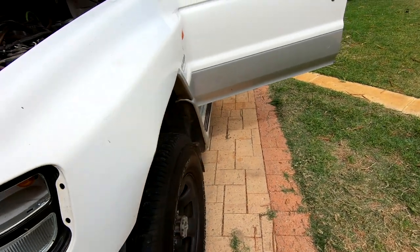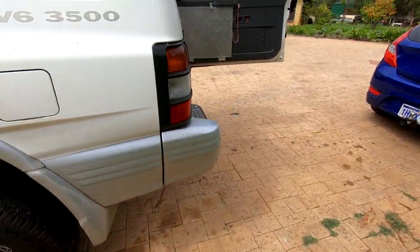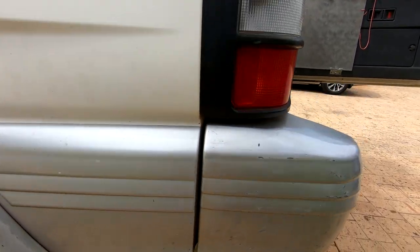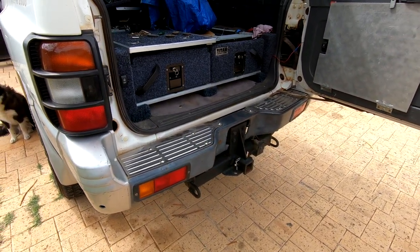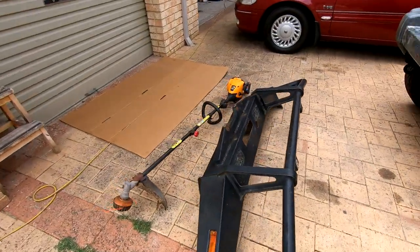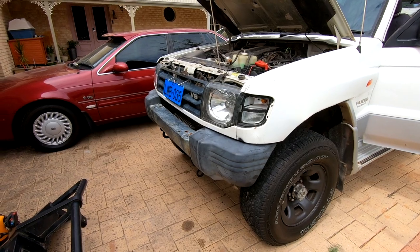On bumpers: if you're going to do a one inch body lift you can kind of get away with not relocating them — a one inch gap doesn't look unsightly. However on a two inch body lift if you don't relocate your bumpers they're going to sit two inches lower, you're going to have a big gap and it's going to look crap. I am going to pull my bumpers off. The kit has rear bumper relocators — you can option the front ones too. Because I've got my ARB winch bar going on, I'm actually going to re-weld my original bumper mounts, strengthen them up and mount them two inches higher as I've done on my previous cars.